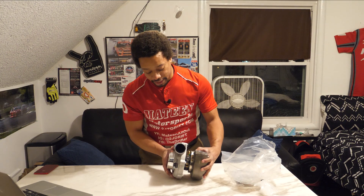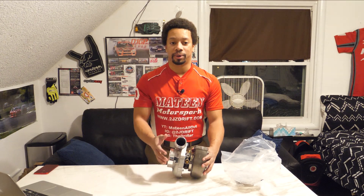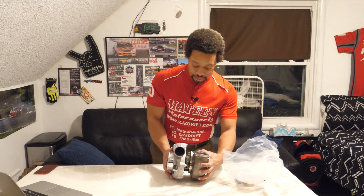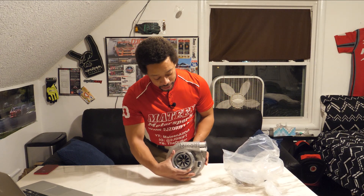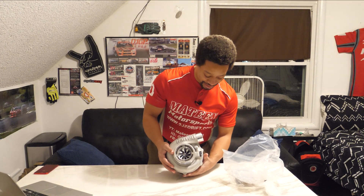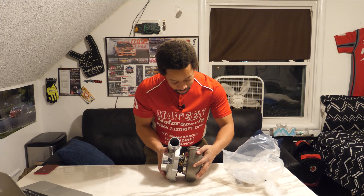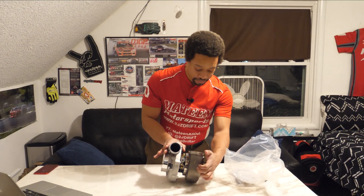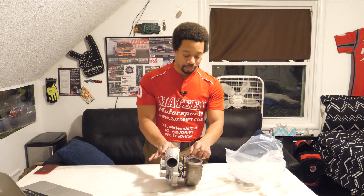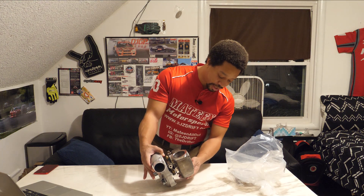One thing that's really cool about these new turbos is they actually come with a speed sensor wheel, which is great when tuning — you need to know if you're over-spinning the turbo, because that'll decrease its life. The quality is really great. You have this beautiful Garrett branding on there — I love seeing the brand written right on the part. You can see the stainless steel; if I didn't know any better I would have assumed it was iron — it looks and feels a lot like iron — but it's that perforated-style casting. Definitely stainless steel though.